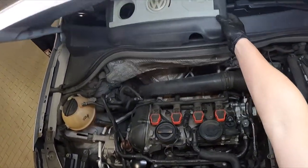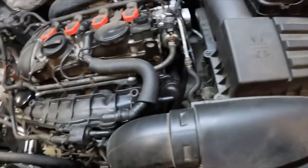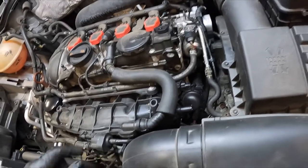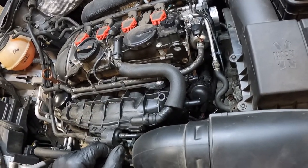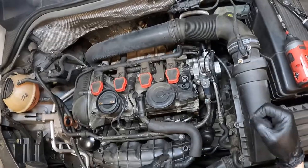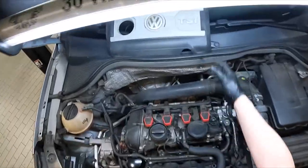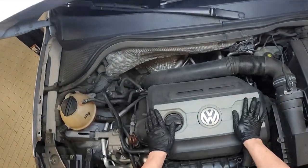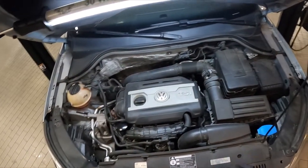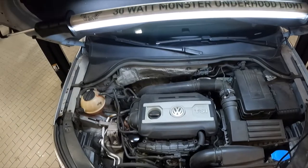You just have your top engine cover and that's it. Once you start the car, the first thing you're going to want to do is look at the high pressure fuel line right there and make sure it's not leaking. If it is leaking, turn the car off, tighten that back up, start the car again, recheck for a leak there, and then recheck for oil leaks around the vacuum pump. If there are no leaks, it's a job well done. As always, I appreciate you guys taking the time to watch this video. Help me hit that 1,000 subscribers — like, share, comment, let me know what you think. I appreciate it, guys. Peace.